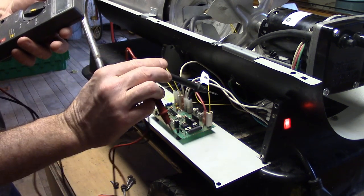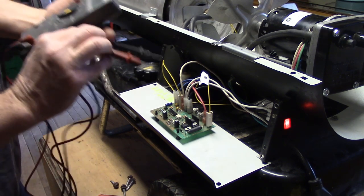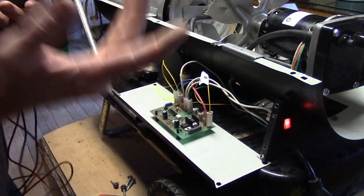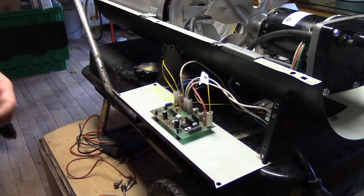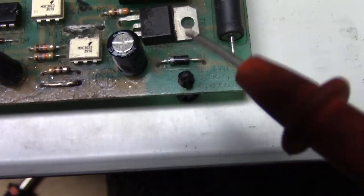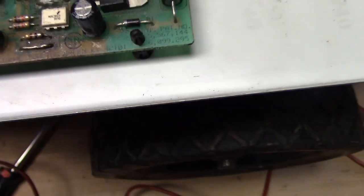Let's check these two yellow wires — that is the igniter, which is what should be running right now — and we have nothing. That tells me the board is probably bad. Looking up close on the board, right here should be a resistor but someone has soldered a piece of wire in there, and right here should also be a resistor but someone's soldered a bunch of wire in there too. So we'll go ahead and change this board.